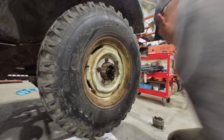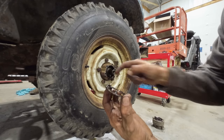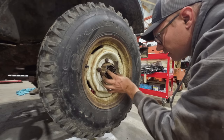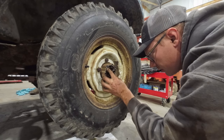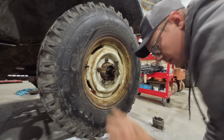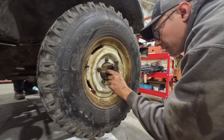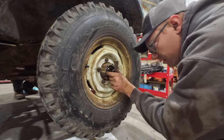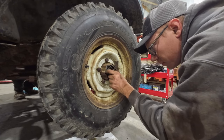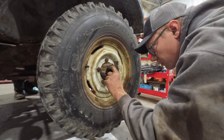So we should be pretty good there. You got a locking washer here, and it's got a tab that engages with a slot in the axle hub here. Spindle hub, I guess it is, technically. And you got your locking nut that's got 65 years of farmer chisel marks on the edges of it from tensioning it. So we'll just continue the tradition.